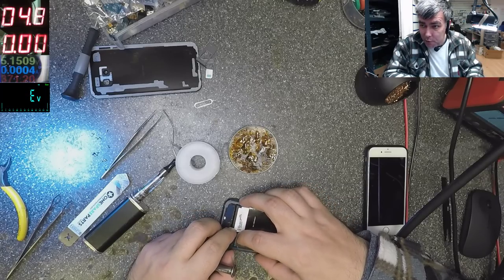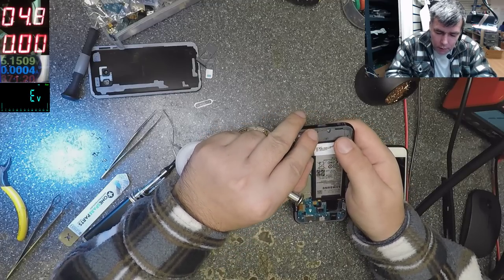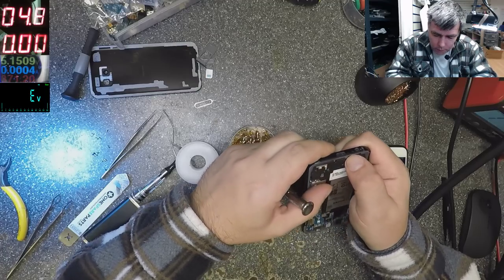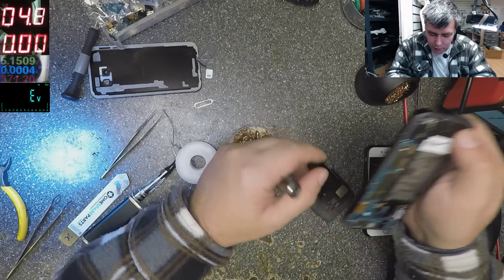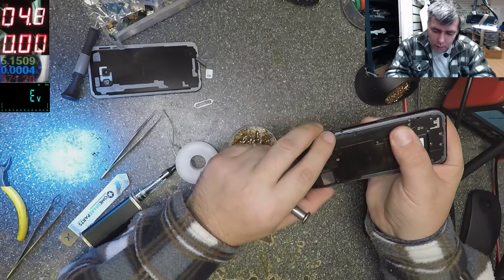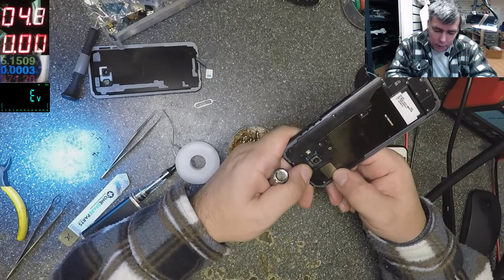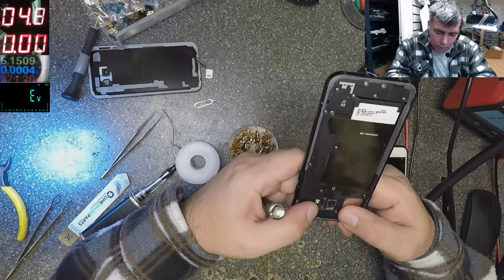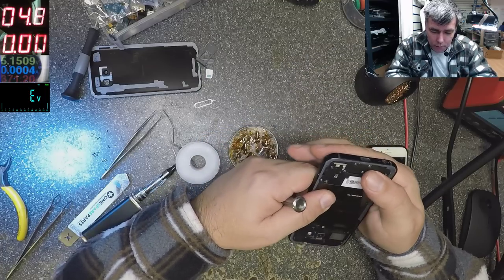And if you think this is a cheap job, you are wrong. We are charging £50 for this job, because people are still confused and they don't know what to short. So now you know what we have to short, those two resistors, yeah? If you have a different design, go on Google, check the USB-C pinout and short the data lines, yeah? You need data lines, that's what you need, and plus and minus. Okay?